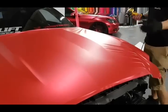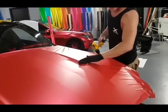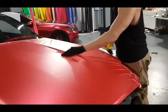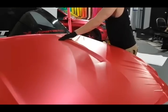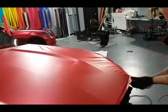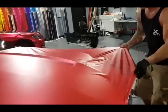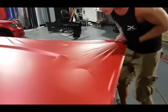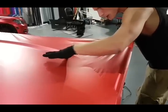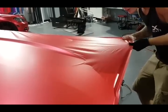I don't even see a single buffer or swirl mark in this film. Even with monkey strips on my buffer, on any kind of chrome or gloss, we always get some kind of swirl mark — they usually post-heat out — but there's nothing on this at all. I actually don't need to use any heat. We have the high and low points again. We're going to work in the low point. I need to create a bit of relief here.